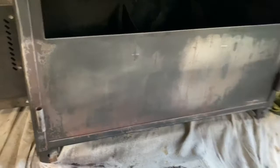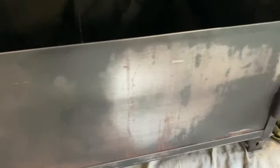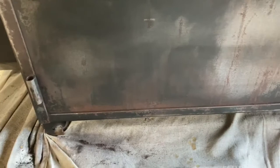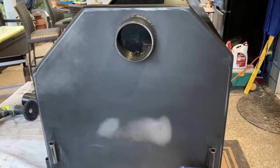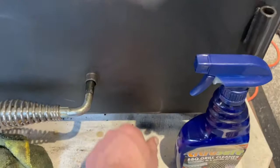Let's wrap up night one. I'm still not real happy with the front — still got some work to do. I went to the hardware store and got a drill attachment rust stripper; I'll need to put it on a more powerful drill. I'm not afraid to take this down to bare metal. On the right side, the orbital sander with 120-grit worked like a champ. Got a little mark there but I can buff that out before paint.